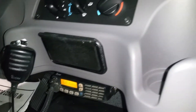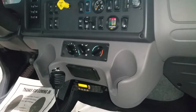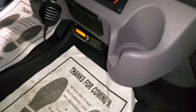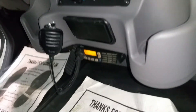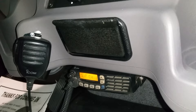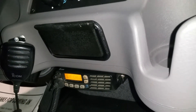Here I'm just showing you how I installed the radio and it looks good — and that's not only my opinion. I've done installations here on the top, and today I did not have a faceplate adapter, so I ended up installing the radio here. It looks alright and I'm happy with it. The power is set up the way the customer wants — permanent power, so it's not connected to the ignition circuit.